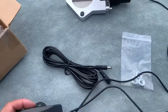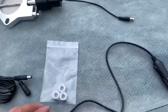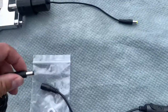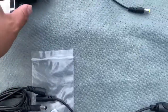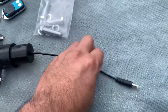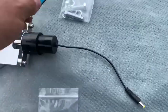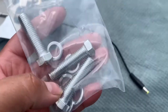Hello, welcome back to the channel guys. Today I'm going to be installing an electric cutout on the Trans Am. It's very simple — it goes to your cigarette lighter, this here plugs in like this, and then you run this cable to the back. In my case I'm going to have a Borla exhaust, so it's going to the back, and this one here has the remote to open and close it. It came with two remotes, and I already have the opening in the back.